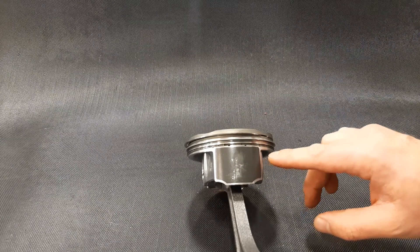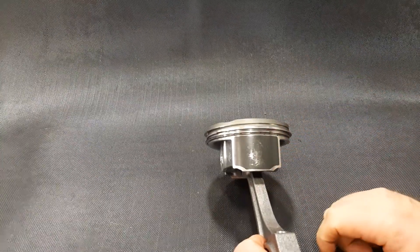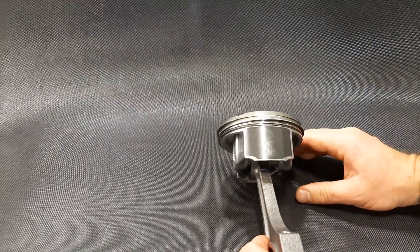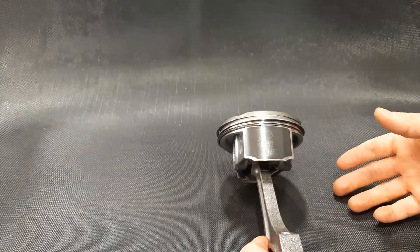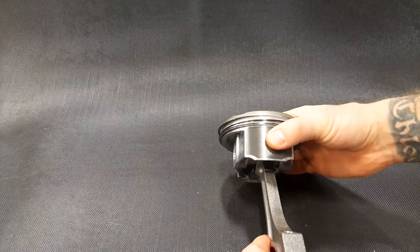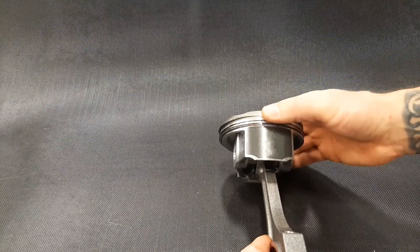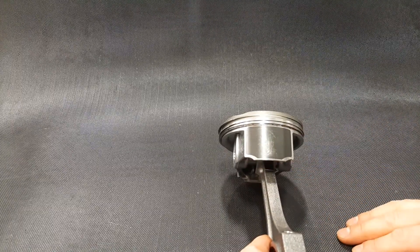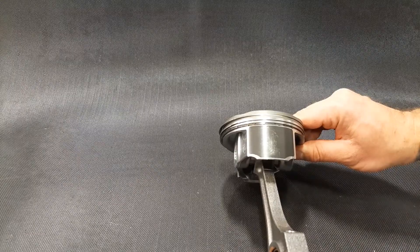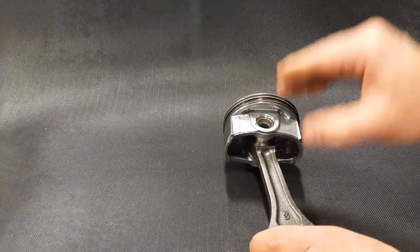This particular piston has an anti-friction coating on the skirt to cut down on wear, and I want to make sure that coating is not compromised. If this were an engine that had a cooling system malfunction or overheating problem, thermal expansion would run unchecked — causing more expansion than wanted in both the piston and the block, resulting in physical contact between the two. The same thing could happen with lack of lubrication, where metal-on-metal contact tears up the cylinder wall and the piston. If we saw that, we'd need to bore the block and fit new pistons, and identify and correct the failure before returning it to service.